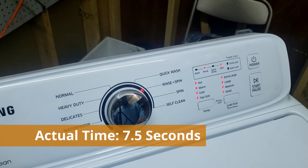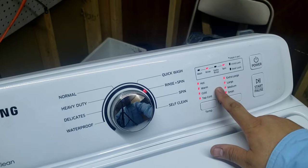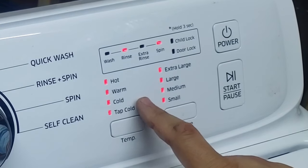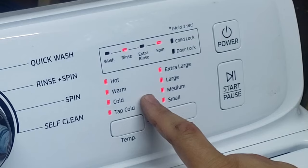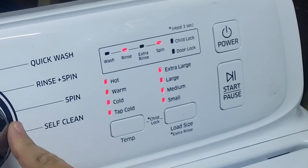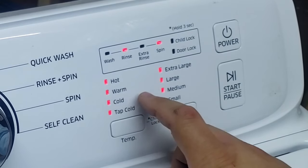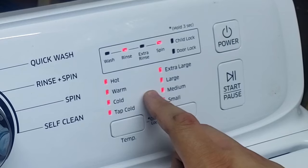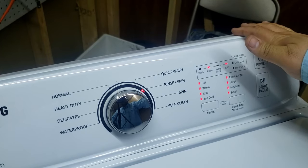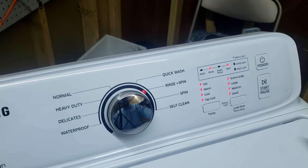There we go — we have entered the diagnostic system. This will show you multiple combinations of codes. Certain ones will be on entirely, and the ones that blink are the actual codes, so whatever is flashing corresponds to the fault code. If a light is on solid it may not mean anything at all. You can go through all failures and faults in this washer by spinning the dial. In the case of this washer, the only code showing is the hot and the cold. I have the tech manual, so we're going to go through every possible code this machine has and what it could mean according to Samsung.